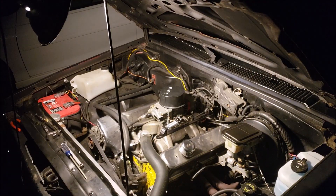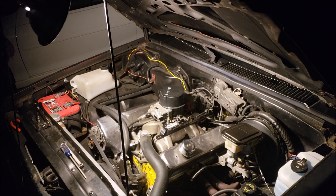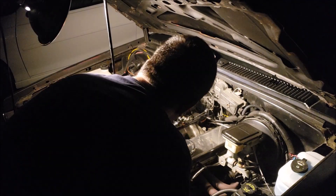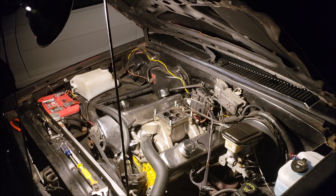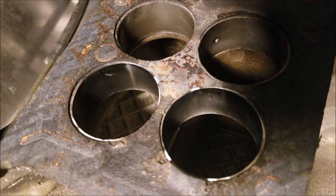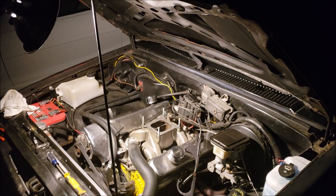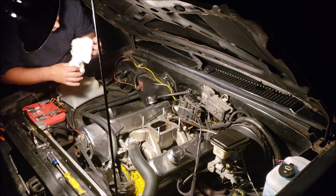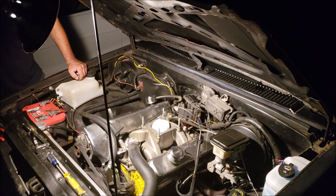In this video we're just gonna do a little time-lapse of swapping out this carburetor. We're getting this old one off for a couple reasons — the main reason being there's nowhere to hook up a kickdown cable to it, and with my new transmission I decided to go with a kickdown cable this time, not a full manual valve body. You can see there the gaskets looking pretty rough on that old spacer. I'm gonna get rid of that spacer and put a wooden spacer in there and see if that helps with the heat.